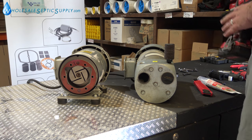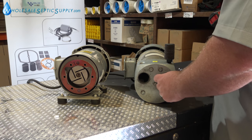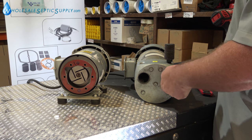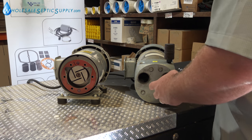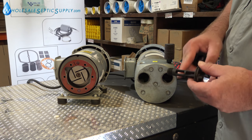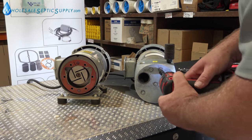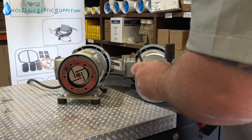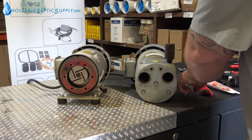You don't have to take them off. We don't take them off when we rebuild them in the field — we just rebuild them right there. For these inlet filters, you're going to want to tighten it slightly and then get it loose. If you don't, what will happen is because these are hollow, it'll snap off inside. We have the parts to fix it, but it makes the job a little more difficult.